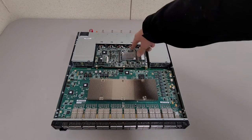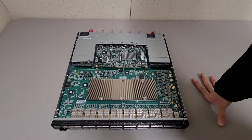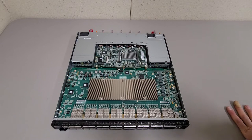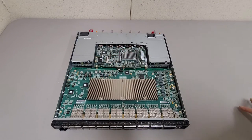This appears to be the brains of the unit — I believe this is an Atom-based processor. And that is an 8 gig stick of PC3-12800E ECC memory. I'm not sure how big that is, but that appears to be an mSATA SSD.